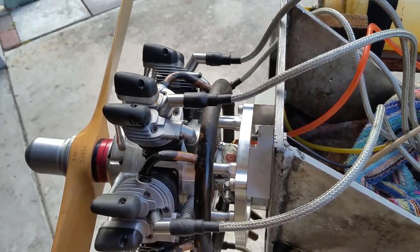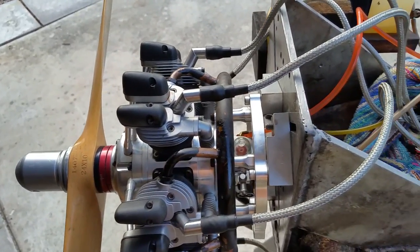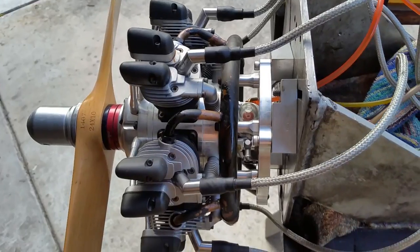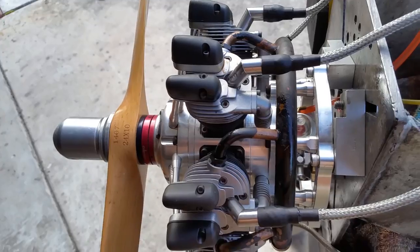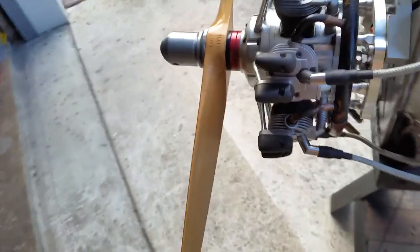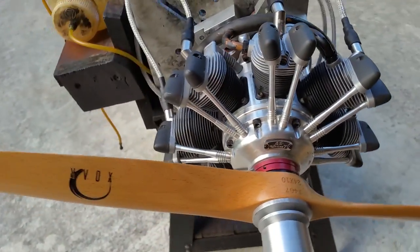You just have to adjust the flow with the engine running at full speed at the top RPM so you get the right amount of fuel. I ran it a little bit earlier — it idles pretty good, very good transition, top end is pretty much like the glow, actually a tad better than what I've seen before.